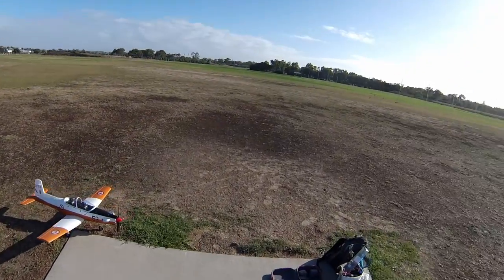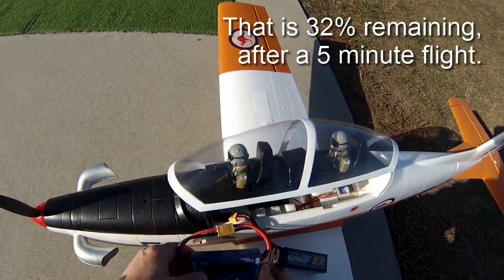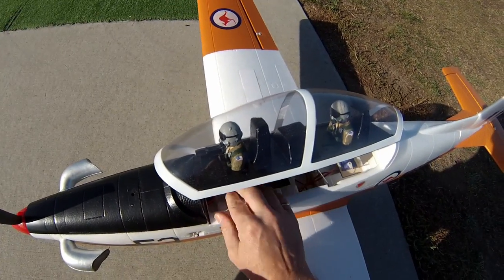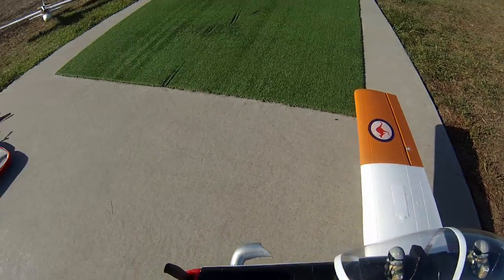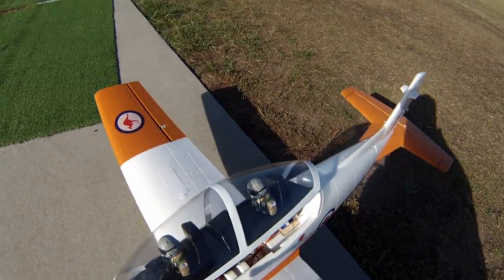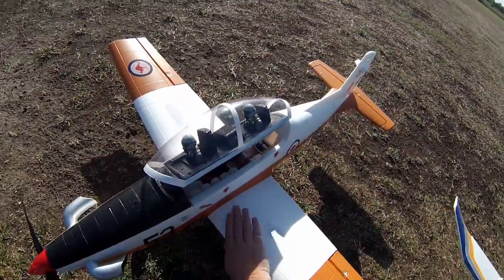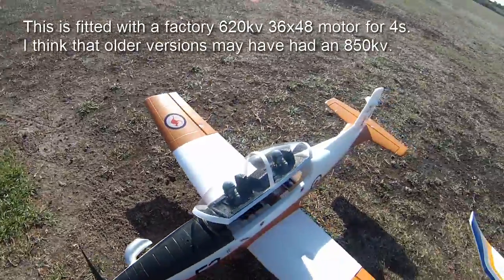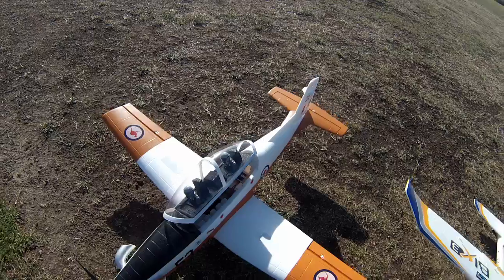Let's check the battery — 32. Efficiency-wise it looks about the same. Without hard stats on speed, it feels like that's a bit quicker at full throttle. So there you go guys: 12x12 on four cell is an option. As for three cell, I think on this motor the KV is a bit too low and I wouldn't recommend it.